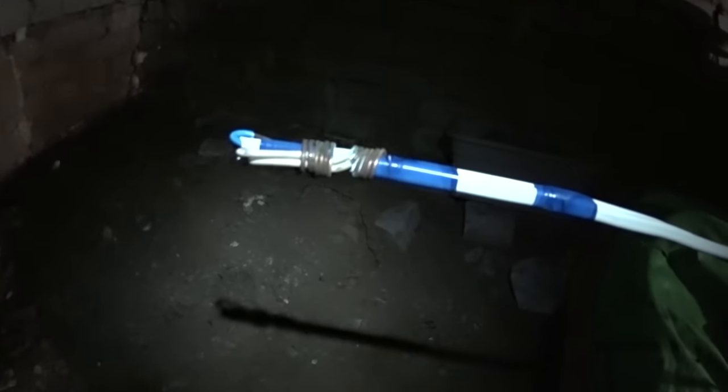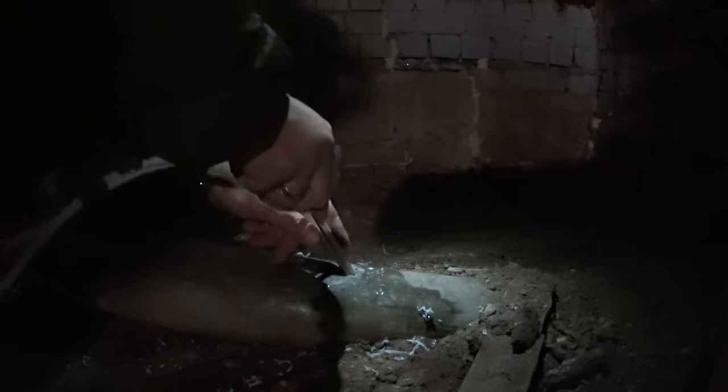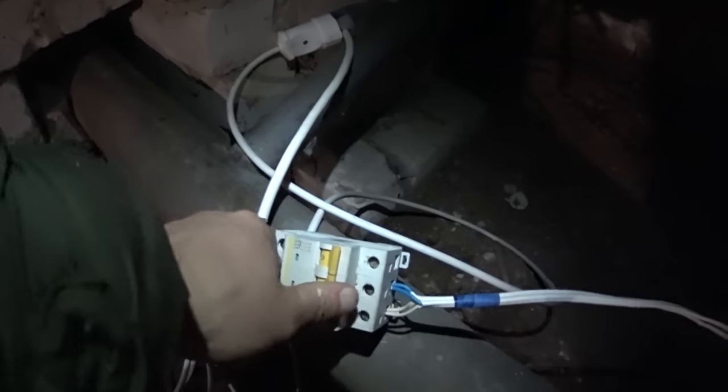Here we have a hole in our drain tube. Here we have our device, which is tested and all that good stuff. We're going to send it out there because that's where we're having our ice block in the tube. We of course want it all the way out to where the ice starts. We'll put a black marker mark here, then just turn it on. And now it's bubbling out there somewhere.